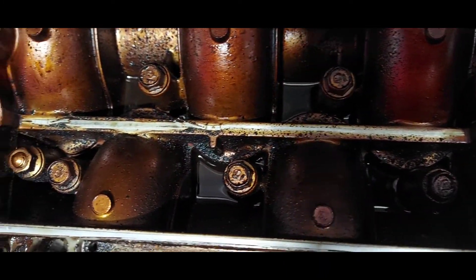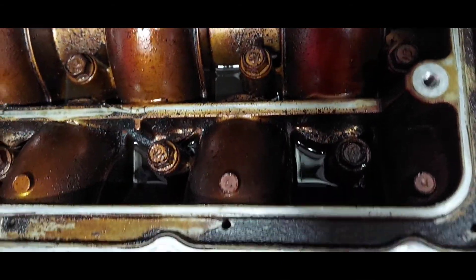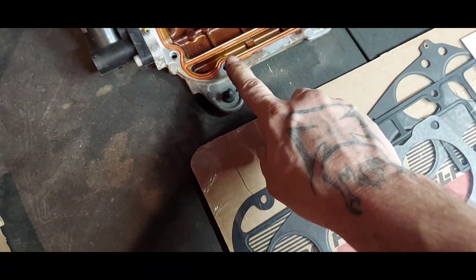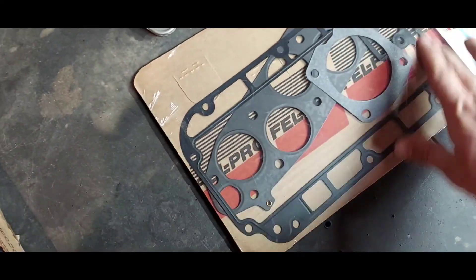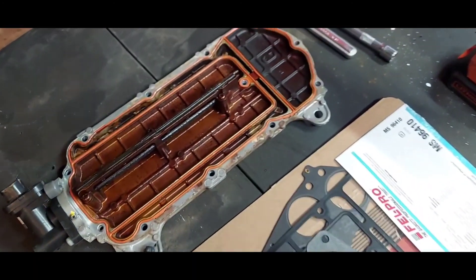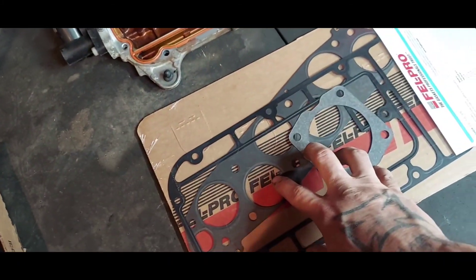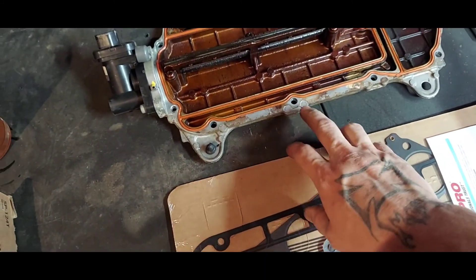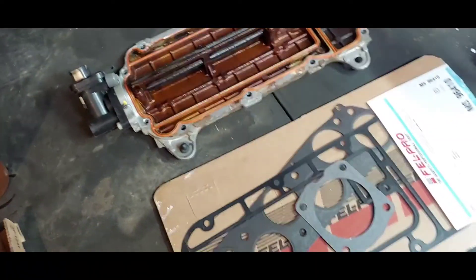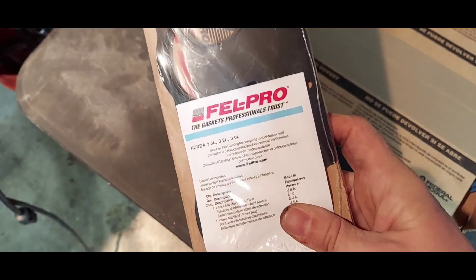This thing is disgusting. I thought this was an intake passage but I think it's actually an oil passage — this one over here is the intake passage for sure. It's cruddy and it's going to need some cleaning. I already ran into an issue though — the gasket that was supposed to go here doesn't look the same. The holes are all the same but this one sits in the groove while the other one looks like it sits above the groove. My nephew is coming over — he's the one who hooked me up with the parts — so we might end up exchanging these if they're wrong.